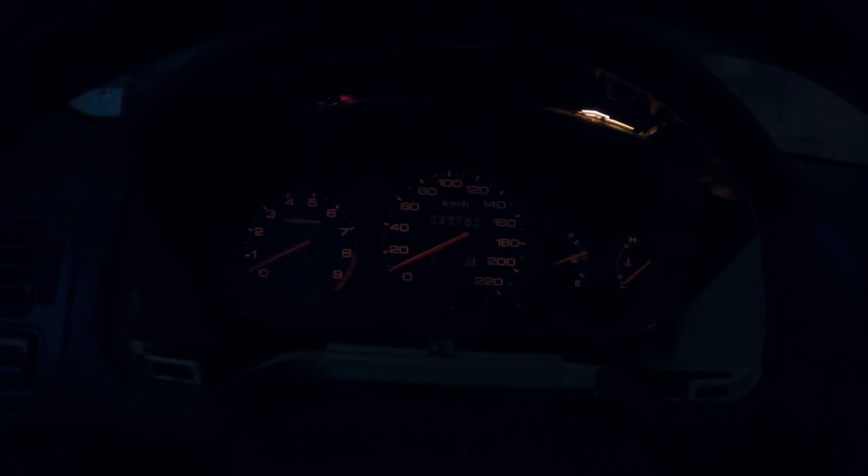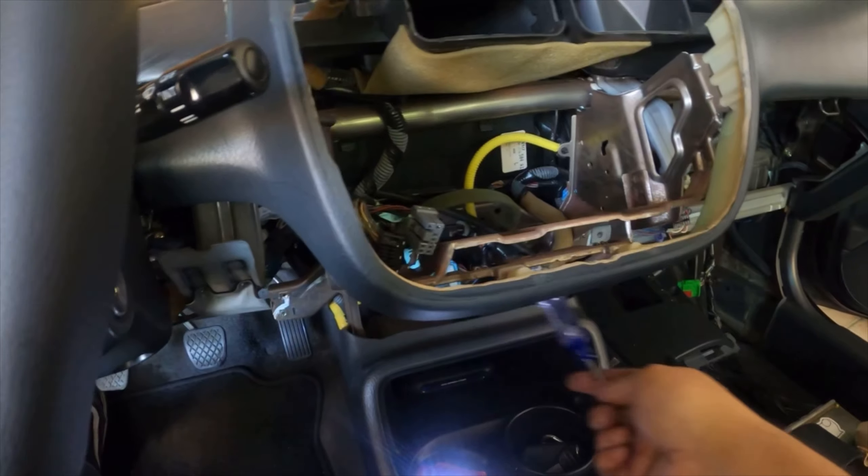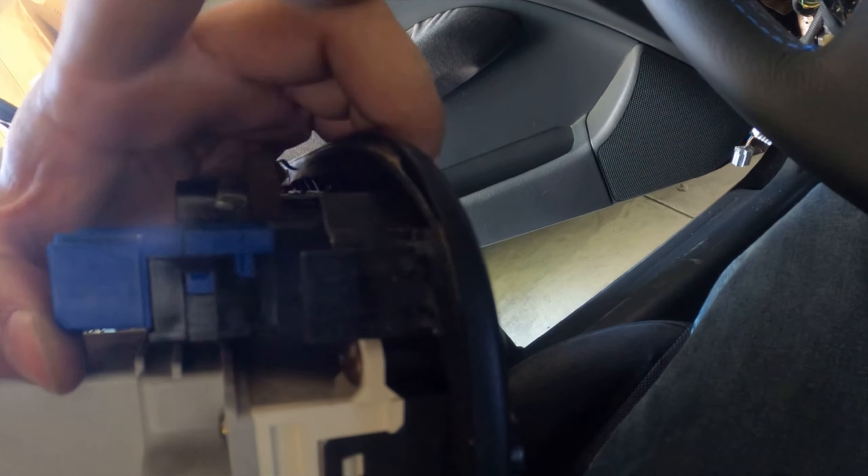The climate control is out — pretty much it's four bolts on the bottom. I removed the cluster so I can remove the clip that's right here on the side so I can press it in and push it out, because you don't want to break these clips. Now we're going to get to these two bulbs, and the other two are going to be along the inside. We're going to have to remove this whole little assembly right here — that screw there, one back there, and one here — so that we can get to those lights.